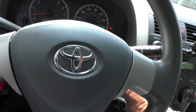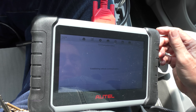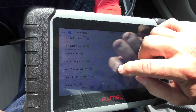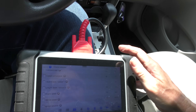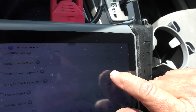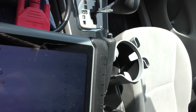We'll look at some live data to see what kind of shape this baby's in. The alternator's charging fine — 13.6 volts. AC still blows freezing cold. Short-term fuel trim: we're turning the AC off for this, because having AC on will often mess with your fuel trim. It's reading like 2.3, 3.9 — so it's adding a little fuel. It's running a little bit lean, and you'll often see these things run a little bit lean as they age.